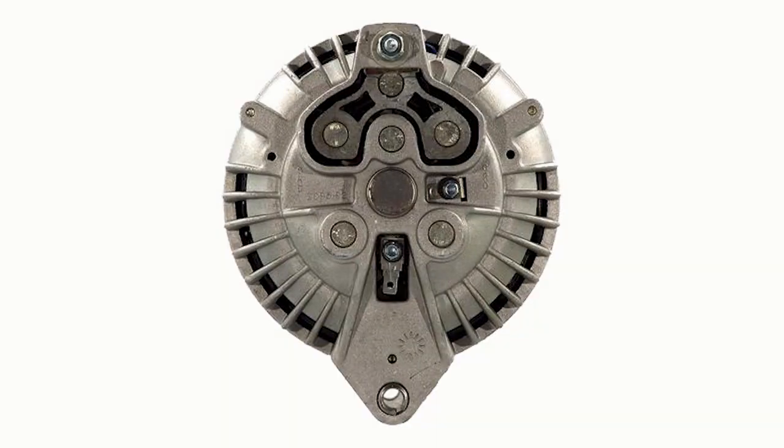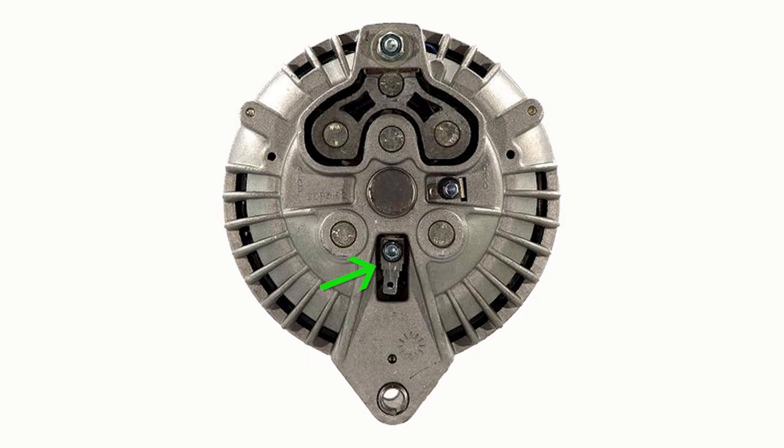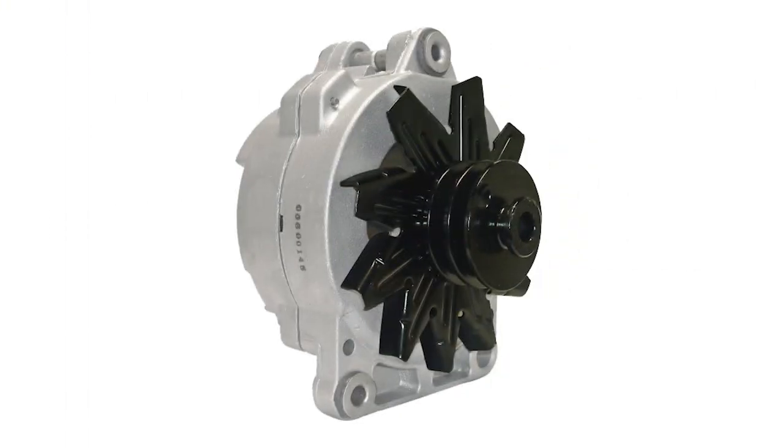All round back alternators from 1960 to 1968 were single pole terminals on the back. In 1970, they moved to a two-pole setup to go with an electronic voltage regulator. In 1972, Mopar moved to the square back alternator, which has a little better amperage. The round backs tend to be only about 60 amps. The bigger 100 amp alternators had a bigger, heavier duty case with different mounting brackets — most of those 100 amp setups were for police and ambulance packages running lights, sirens, and air conditioning.